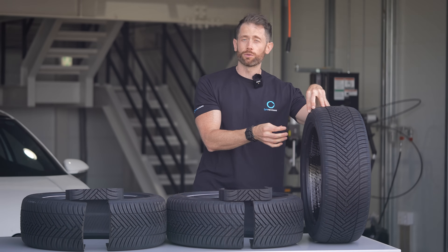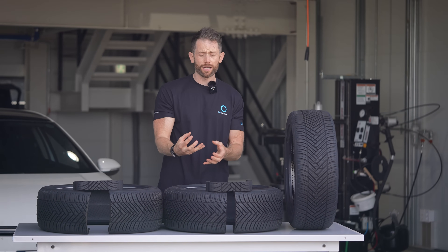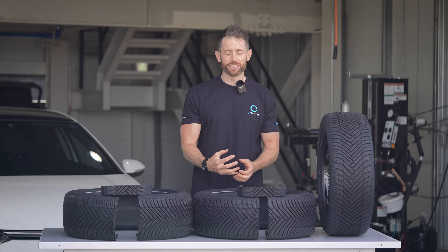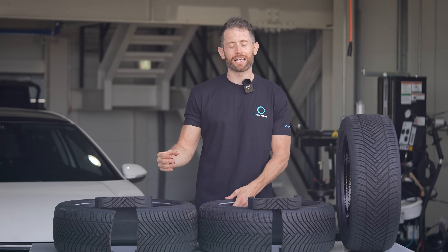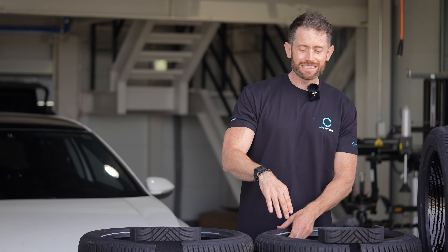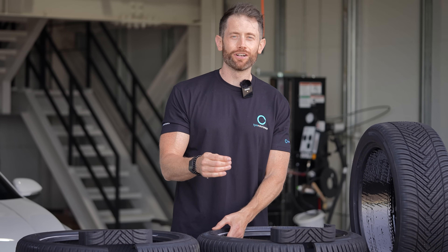Anything at the apex or the sidewall is going to cause a deflation, and the run flat tyre is the only tyre you can run on deflated. If the seal tyre gets a puncture or cut where it's too much for the sealant, that tyre will go down and you can't run on it. A run flat will get you safely back to where you're going. As for disadvantages of this fourth generation run flat tyre - it is hugely impressive. Forget everything you know about old generation run flats. This tyre can be fitted to a normal wheel on a regular car - we're using normal VW wheels - and it is the ultimate in safety without as many issues in terms of comfort, noise, handling and wet grip.